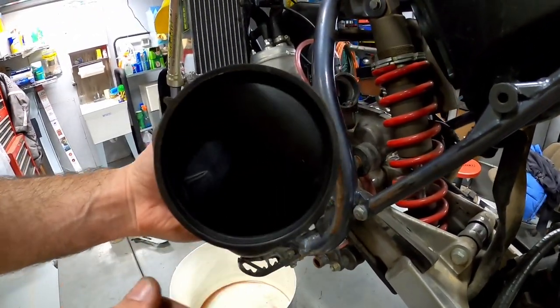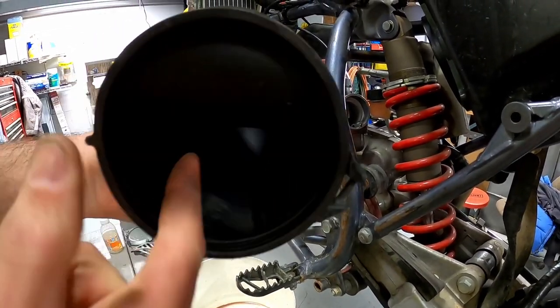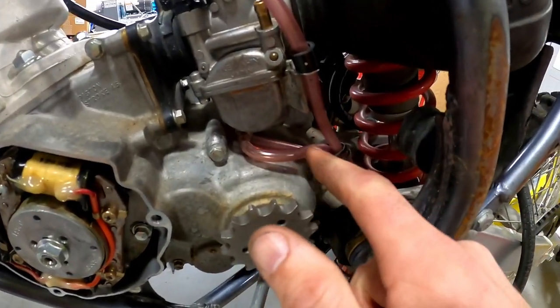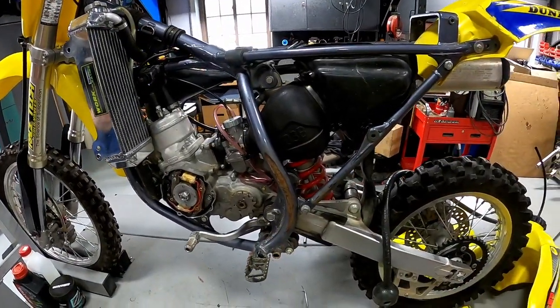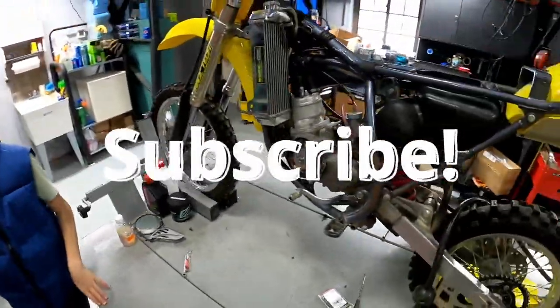Now's a great time when reinstalling this to clean the whole area out — take a paper towel with some starting fluid. It might look clean but there's a bunch of residue in here, so we'll clean this out before we reinstall it. Whenever you're done, just make sure you route your hoses down properly so they don't get pinched off underneath the carb. This Suzuki's kind of cool — it's got a couple different clamps that pull them nice off to the side. This is Jared at 3C's — that was a carb check and clean. We're going to do a bunch of videos on this RM85, check them out. We also do a ton of Beta stuff — check out our channel, subscribe, and stay tuned for more videos.